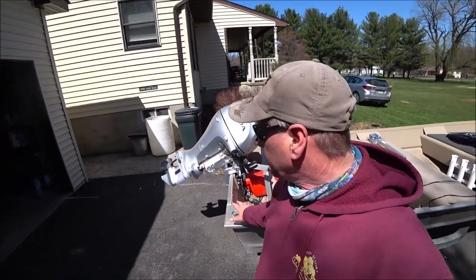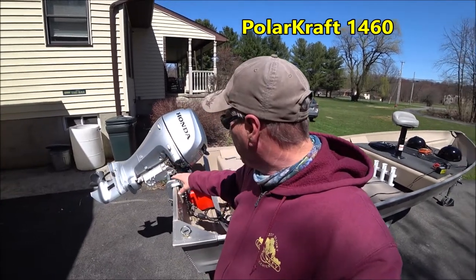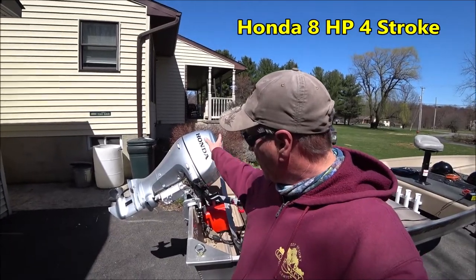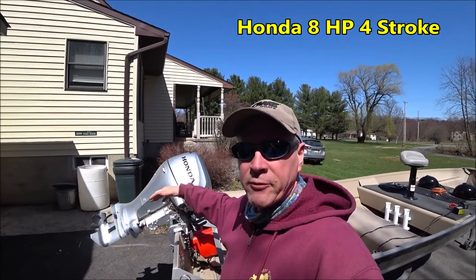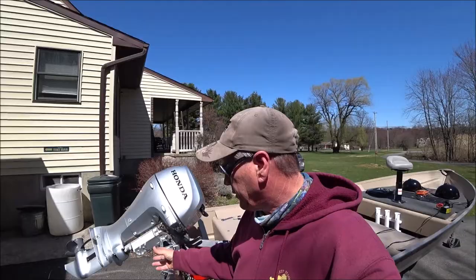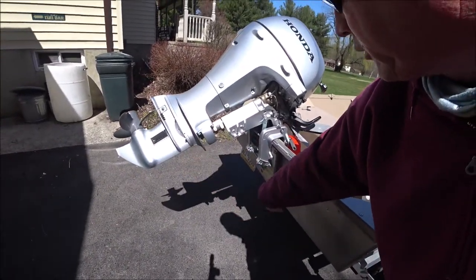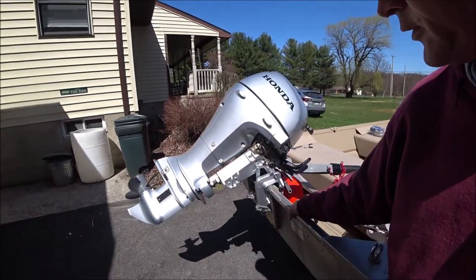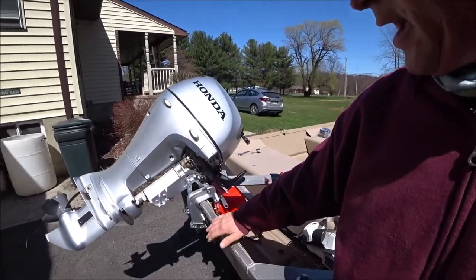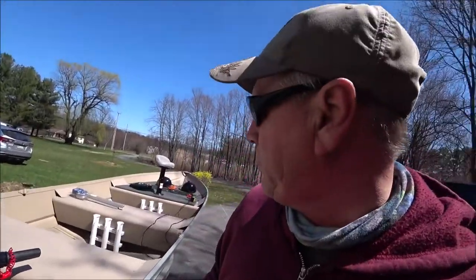With these aluminum boats and four-stroke motors being heavier than two-stroke motors, you don't want to trailer this boat with that heavy weight bouncing around when you go over nasty roads that aren't real smooth. So we want to attach a transom saver, and what that does is it allows the motor to rest on a peg hooked to the trailer. That takes the weight off of the transom and distributes it to the post that goes down to the trailer, which prevents your transom from being weakened from flexing all the time. So that's what we plan on doing today.